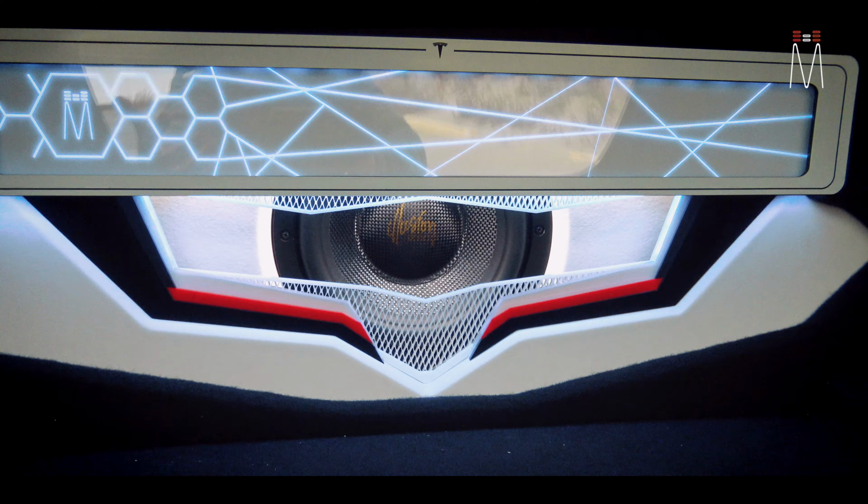Now, it's really weird how they have that grill, because the bottom of it's actually plastic and then there's a piece of steel. So there is no vent from the trunk to the inside of the car. And obviously, to cut back on pressure inside this trunk and resonance, that pass-through was very necessary. And it worked out nice because there's already a grill in the factory rear deck. So it looks factory from the inside because it is factory, but yet we have a massive pass-through here.